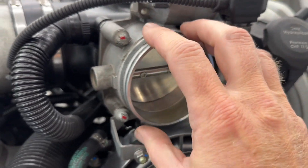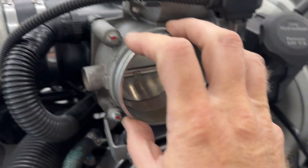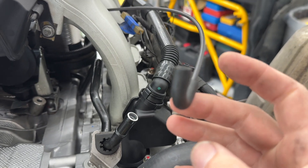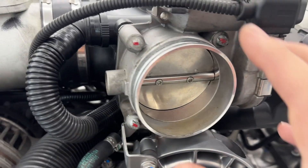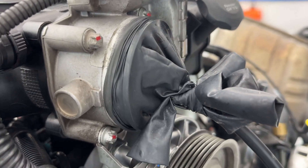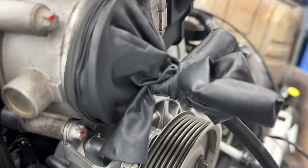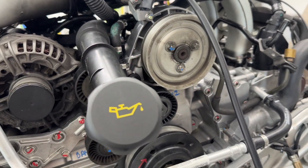The way we're going to do it is I'm going to introduce the smoke through here — it's got enough of a crack that it should go through. The only place I'd expect smoke to come out is this vacuum line that attaches to the airbox, so we can just plug that off and smoke test. My airline is going in there — I poked a hole through a little work glove, and that seal is super tight. I just tied a knot really tight around the hole in the opening. So now we sit and wait.